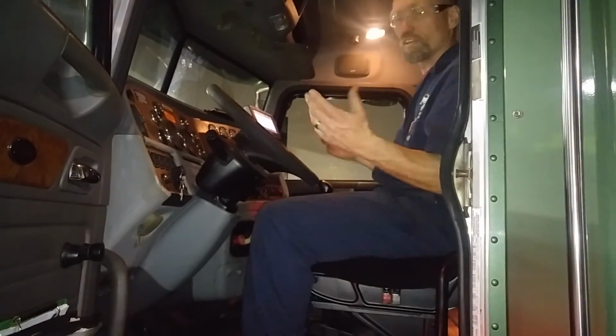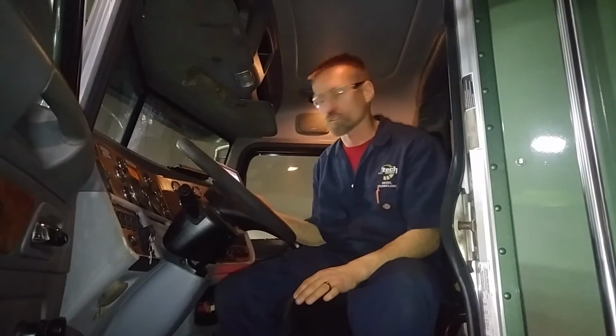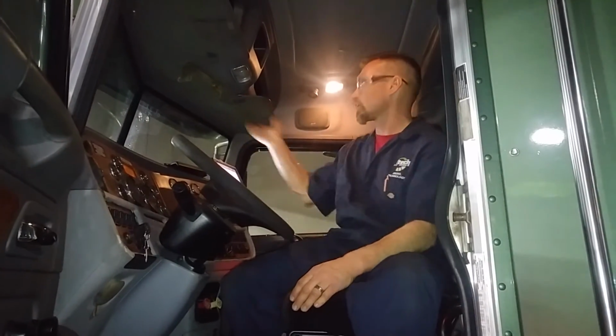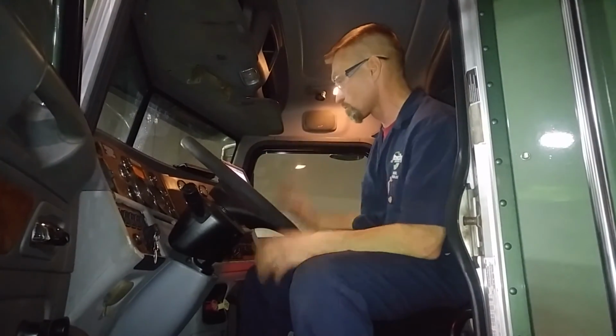Function through. And then in here you're also going to want to check the backrest, the lights on the interior and exterior, or the interior in the cab and the sleeper. Look for any other signs of physical damage. Check if the heaters are working, all that good stuff. Checking obviously, like I said, the glass and all the mirrors, looking for any damage on those. Make sure they're angled right and make sure they do move if need be.